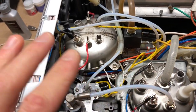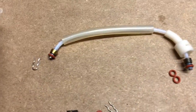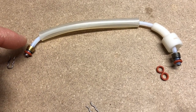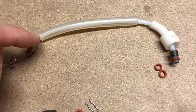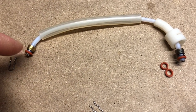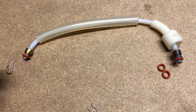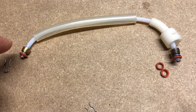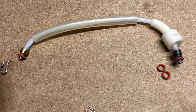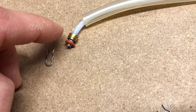So you have two different sizes: the larger one for the probe and the smaller one for all the high-pressure hoses. This is a very common sealing solution on this machine — all the hose lines that use this white Teflon high-pressure hose use this solution or some variant of it. There are actually four variants of how these seal, which is really why I'm making this video, because it gets confusing when you get into the different ports. Even though they're all high-pressure hoses, based on what they do they have a slightly different stack-up of parts.